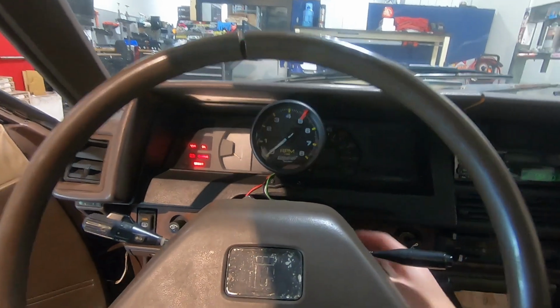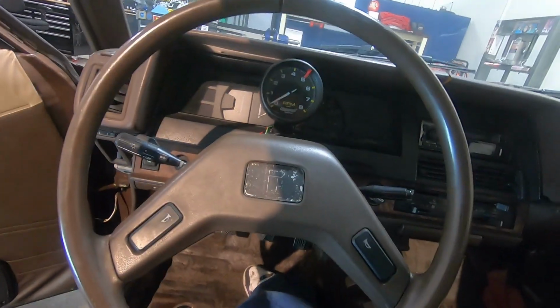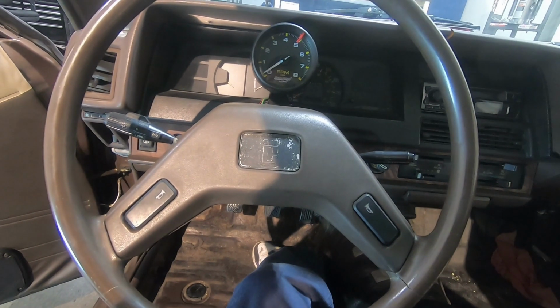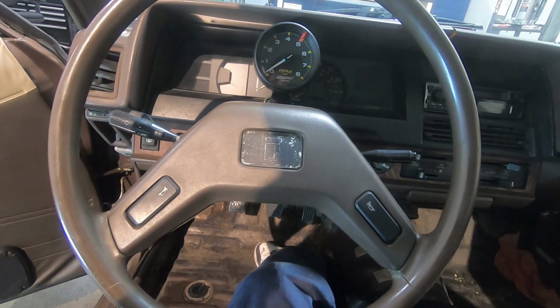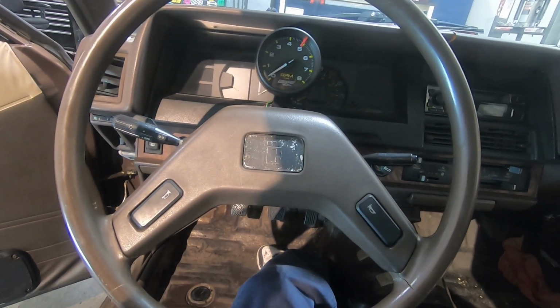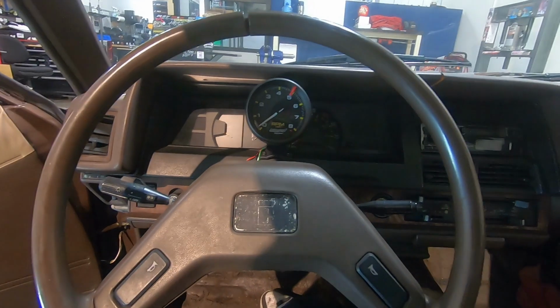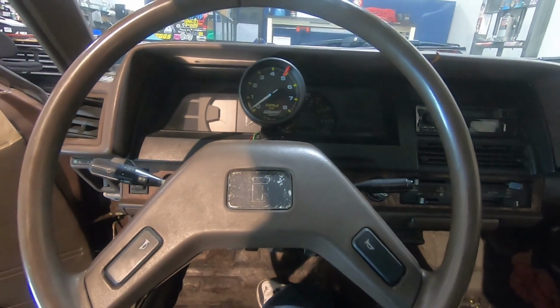There we go. If you're gonna rekey your car, I would recommend bringing all your lock cylinders and your ignition switch to the locksmith, because they told me they had cylinders in stock too. So yeah, pro tip, if you're gonna rekey your car, talk to a locksmith first. Don't be like me and just buy stuff and expect it to work.